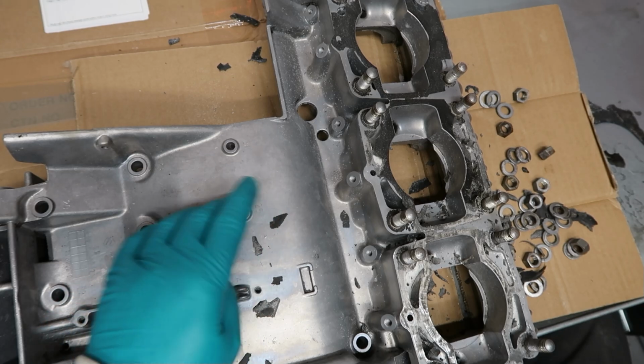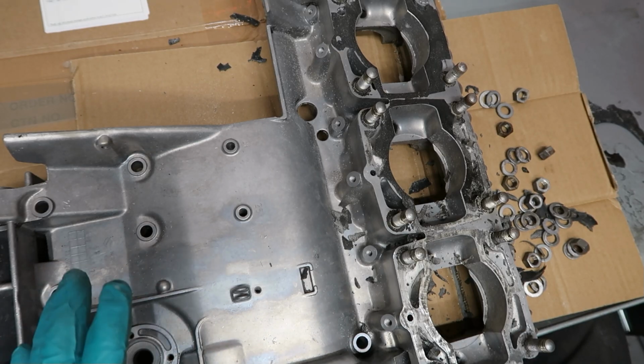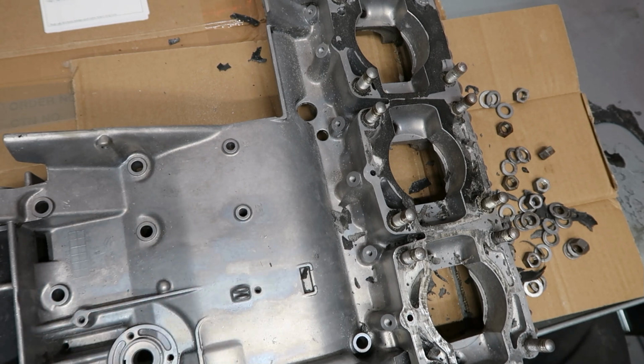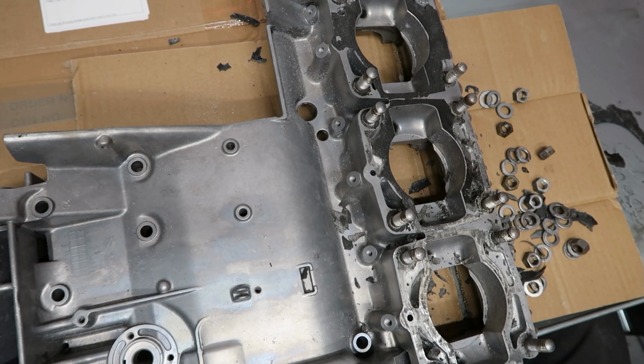The other thing is to go on the forums and ask. You know, I've got this really old engine, it's as original. Does anybody know if there are any issues with asbestos in any of the gasket materials on this engine? It even used to be in rope lagging, so for seals and things like this, crankshaft seals. I can only speak from my experience, and that's what I've seen. I've probably done around 20 odd engines, boat and motorbike engines. It's never really come up, but you get an impression. If alarm bells are ringing because of the age of the bike, take precautions.